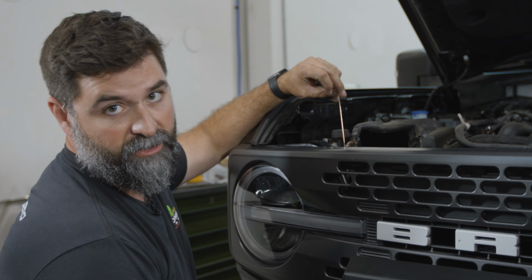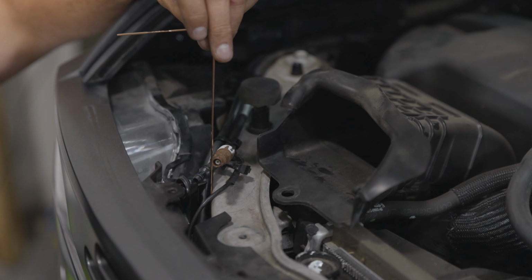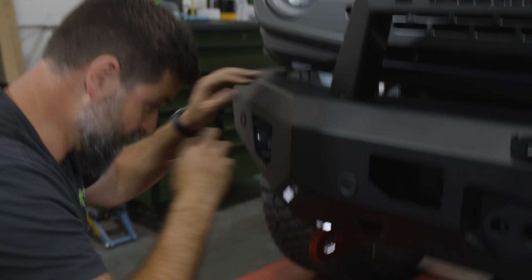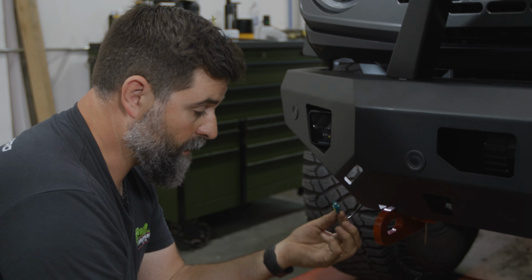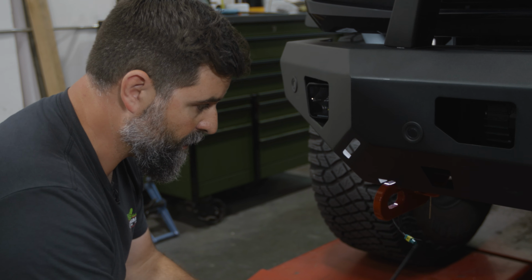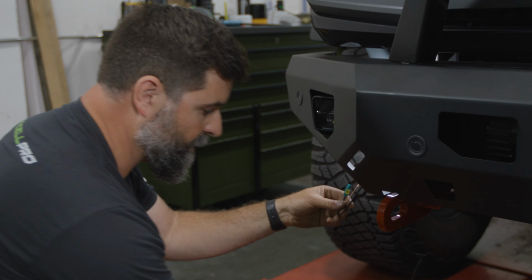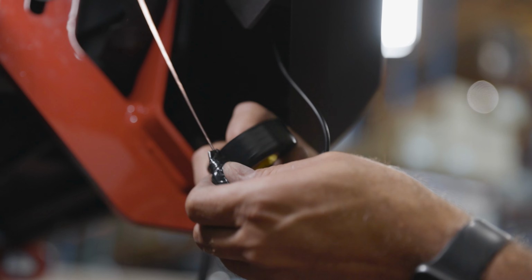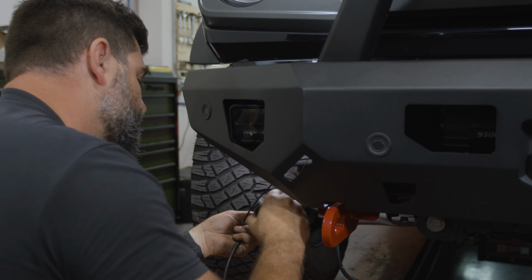Throw a flashlight or some light down below, facing back up, and you can see the pathway clear as day. So I'm gonna drop that down. Then I'm gonna move down here to the underside, and I'm gonna run my fiber optic camera cable extension and the sprayer. I'm gonna just tape these onto the end of the TIG wire with some electrical tape, and then we can fish it up through. I don't wanna go crazy because you gotta pull it all back off, but I don't want that piece of TIG wire slipping out either, so.